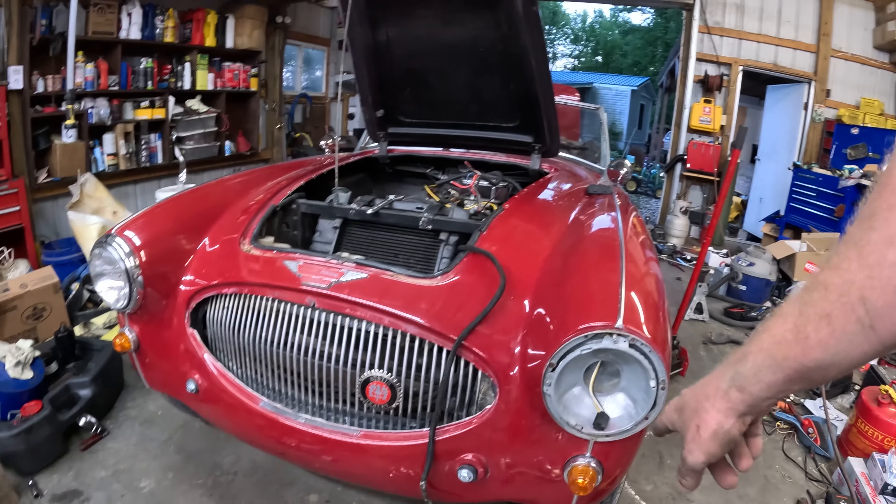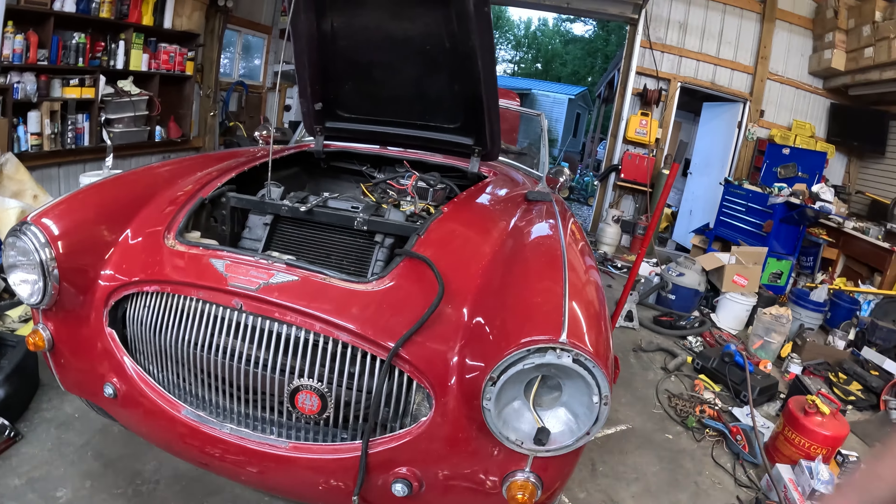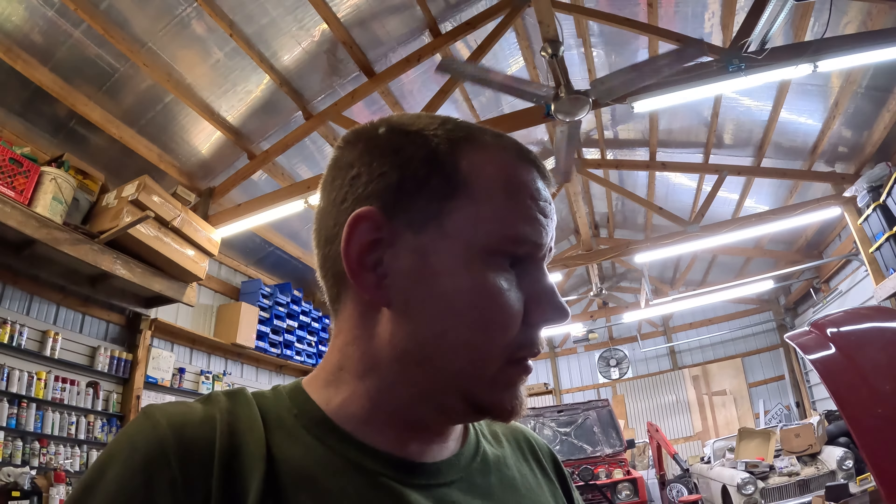This car is basic — you've got high and low beam headlights, turn signal and marker lights on the front, so four lights on the front, five lights on the back, a radio, a horn, and engine stuff. There's a blower motor and wipers, which is easy enough — the wiring's still there for those. The front lights and engine harness will go right back through the firewall holes that are already there. I've got grommets for those, so I'll actually put proper grommets in. There was some wiring close to steering components, so we'll route it a little better and protect it more.